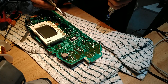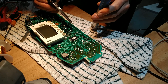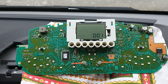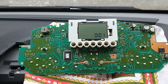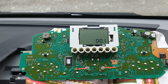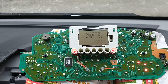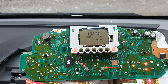So that's what I did with the second one - the speedo and the rev counter - though I forgot to record the dremeling bit; this was just cleaning up the holes. I plugged it back in, connected the battery, and we at least have a clock. Hopefully if I turn the ignition on the left dial should move because I've got fuel in the tank. Good - that seems to work. Excellent - so they're the right kind of stepper motors. I'll replace the other two now and put it all back together.